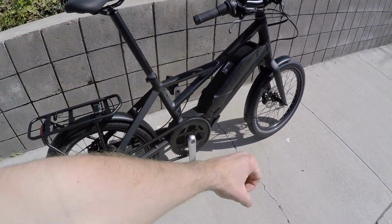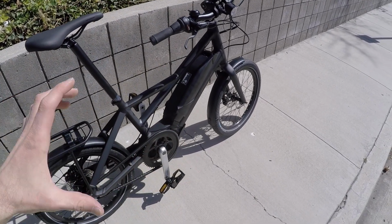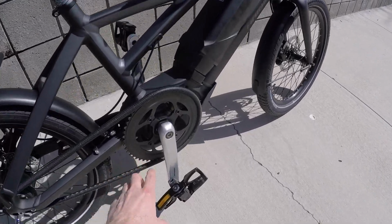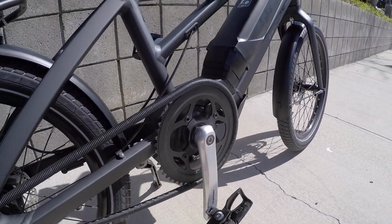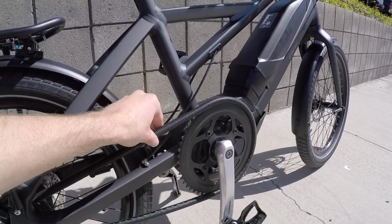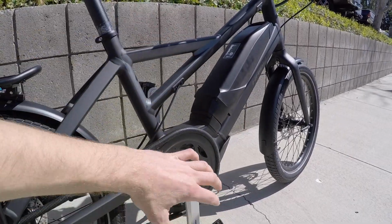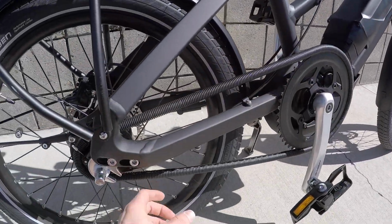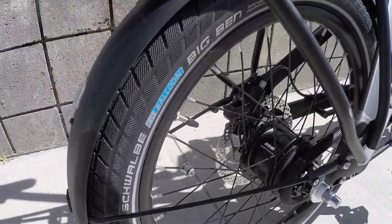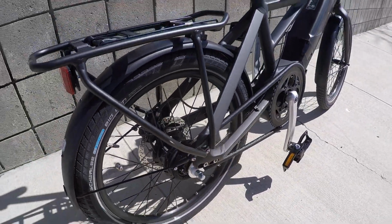You're getting a normal cadence happening, like a longer cadence. It's not like they're 165 millimeters. And then we've got a really big 52 tooth aluminum alloy Miranda chainring, and then this really cool plastic tubing, almost like a chain cover, so it would keep your skirt or your pants from getting greasy on the chain. There's only one sprocket in the rear. I believe that's 18 tooth, and it connects up to this Shimano Nexus Inter 8 internally geared hub. I really like that hub.